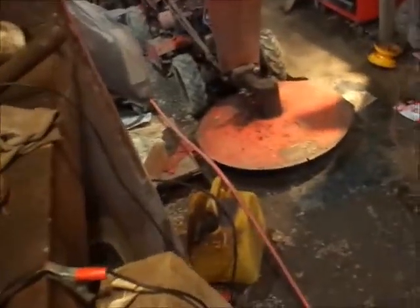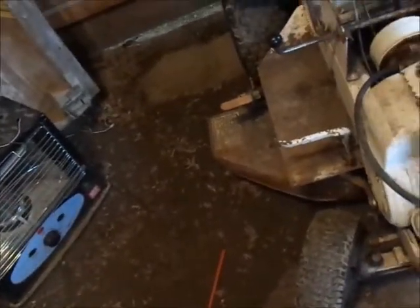So scrounge up 2 bolts, and hopefully the camera can see it there somewhere. But basically, the two bottom ones are AC, coming from the stator, and the top one goes to the key switch by itself. So I'm gonna get that wired up and put in, and I believe I got the right belt for the PTO, I think. So I'm gonna get these put on.